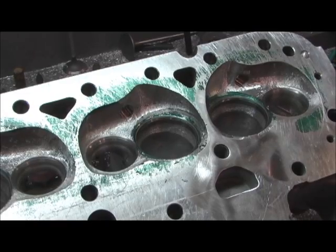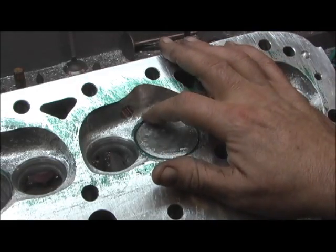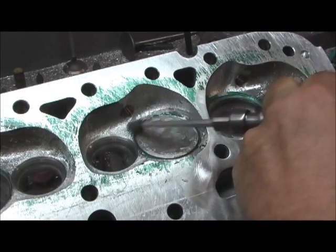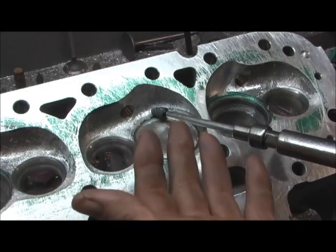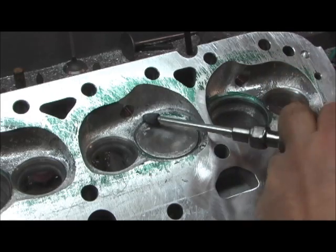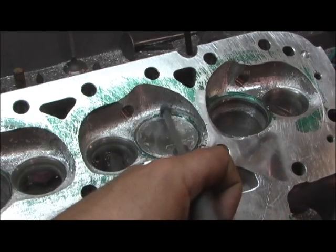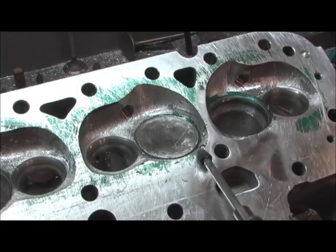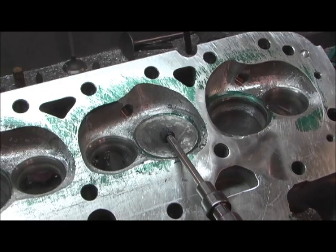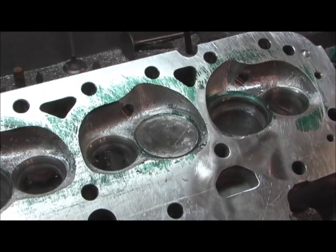What we're going to do here right now — I've got a 202, which is a considerably smaller. There's a baby ridge on the intake, it's not too much. All I'm going to do is go in here like so and knock that ridge down, because as our air is turning it hits that ridge, it can deflect and close. The stone is just going to knock the rough outer edge part, and then we're going to take the sand roll and go in there and hit it to pull it down — but we'll have to do that without a valve. The reason I use the valve with a stone is the stone is a little bit more abrasive, so it can come in there, hit it, and turn it. Basically this is just kind of a rough end, and then I'll go in there with my sand roll and touch it and have a nice little roll right into the combustion chamber.